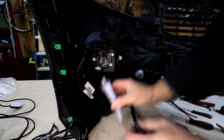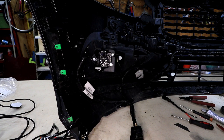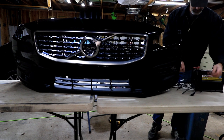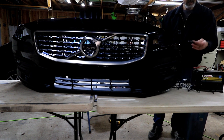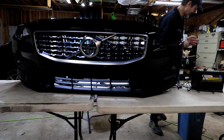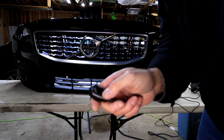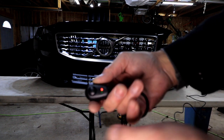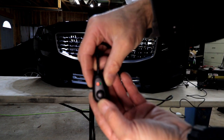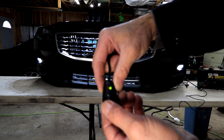I have a test battery I can hook this all up to and see if it works. All my connections are made — I just need to put a ground on. There's a red light on the switch. When I push it, it's going to turn to a green one and the fog lights are going to be bright. Look at that — they both work! Red light says it's off, green light says it's on. They're not too crazy bright, so maybe I'll leave those indicator lights working.